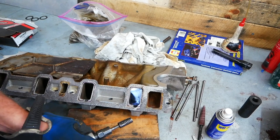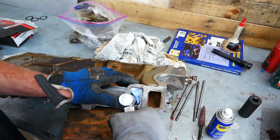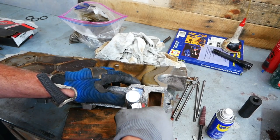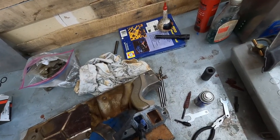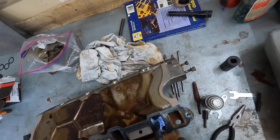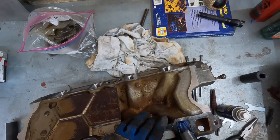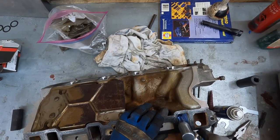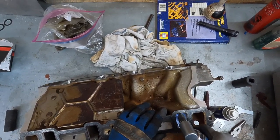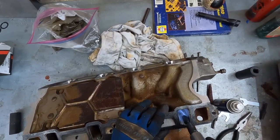So now to drown out the sound of the compressor and the tool, I'll talk over this — you get to hear the soothing sounds of Alpine Garage. At this point we're using that dimple bit to carve out the main part of the lower runner, trying to make it even and get down close to where the line is that we marked with the gasket. Switching over, this cylinder bit was really good for the first part of the runner. Then I switched over to a football-shaped bit — it's got a curve on one side and the other. It felt cleaner going into the edges and didn't create cut lines like the straight bit did. With the oval bit I could feel it gripping and pulling metal off — it was my favorite bit for carving out large spaces.